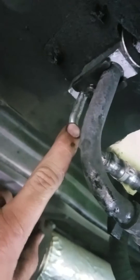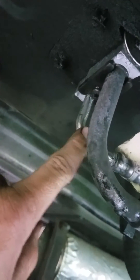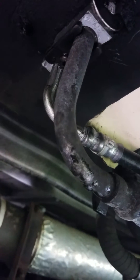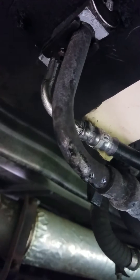It's the low-pressure side, but the high-pressure side is the one where the beads get bunched up and clog the line. I replaced the dryer, replaced the lines, blew everything out, put a vacuum back on it to suck all the moisture out. I did everything for under a thousand dollars and have an almost completely brand-new AC system.